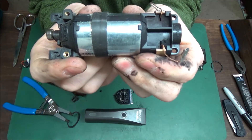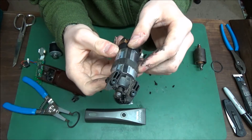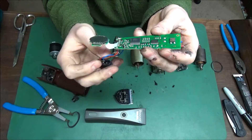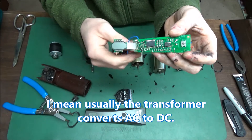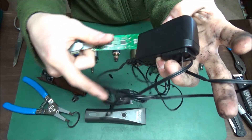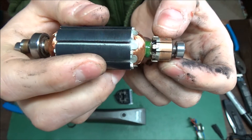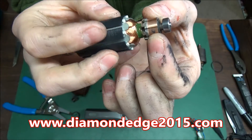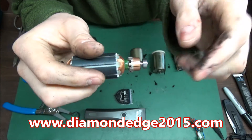This is an SMC. You can see these two wires — I could hook an actual battery up to these and it will run if it's a big enough battery, because it's DC powered. Usually DC powered has a PC board that converts it from AC to DC. This one has a digital display, and the transformer is in the actual plug that charges, so this converts AC to DC to the clipper. It will always get hot.